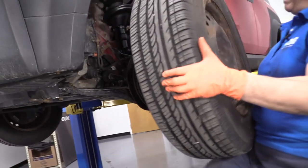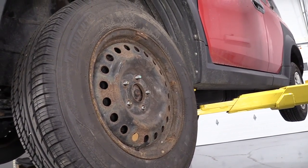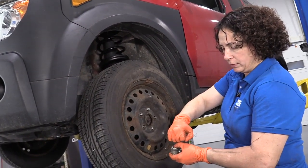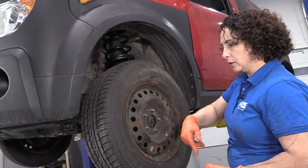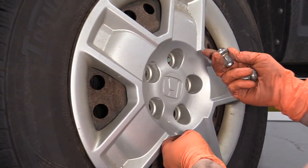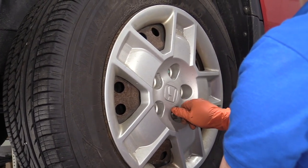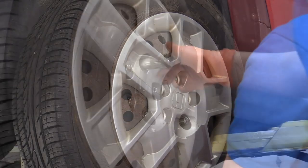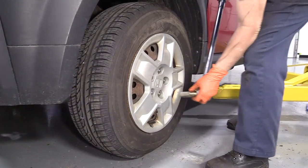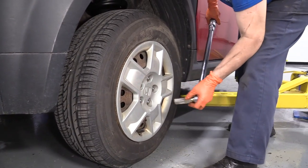I'm going to mount the tire again. The reason I put the tire on before I tighten the top of the strut is because I want the weight of the vehicle on the suspension to assure that I'm not pulling up on the strut cap, which can warp the studs on the outer edge. I want the vehicle weight down and holding it, and then I can get a true torque. Grab your hubcap — this particular Honda does not have extra wide cutouts for the lug nuts. Set the rim up on the hub and put your lug nuts on. The wheel torque with the weight of the vehicle down on the tire is 80 foot pounds.